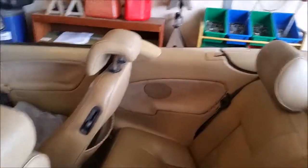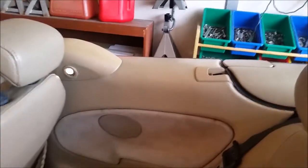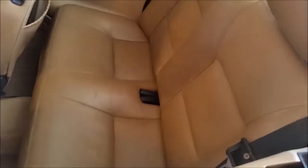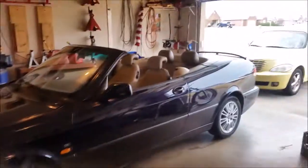Getting at these speakers is a little bit difficult. You need to take off the side panels, which means taking off all the rubber stripping, the kick panel, and then undoing the lights and several screws. It's really helpful to put the seat forward, or even have the seat completely out, if you're going to be spending some time in here. That's my advice on that one — then everything can go back together and it works pretty well.